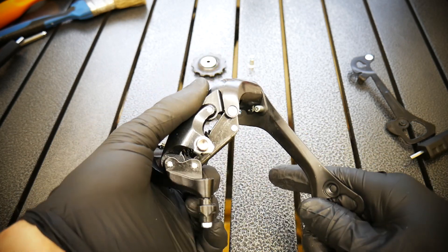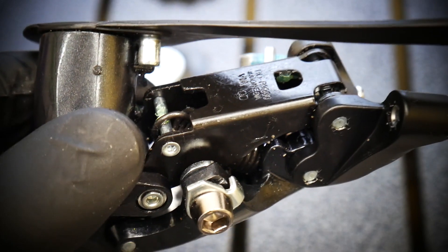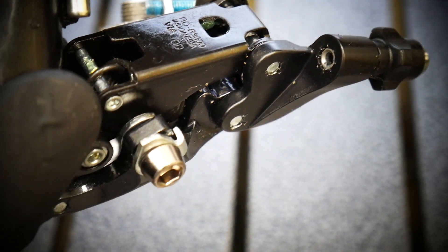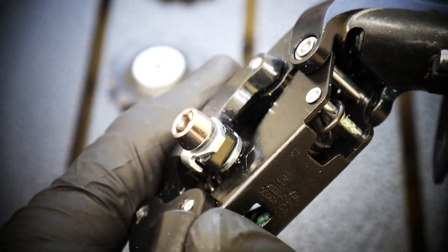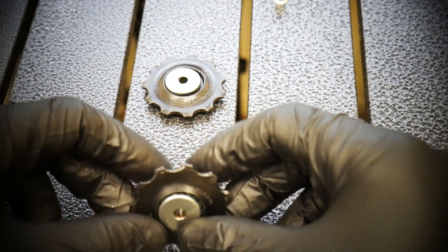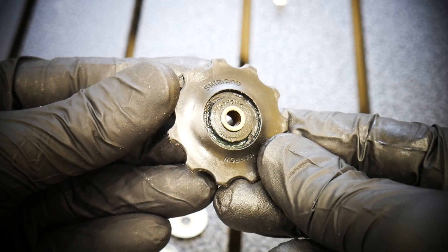You want to have a very nice and smooth movement on these parts. I'm showing you that the new derailleur has got a lot of grease - get rid of it! Shimano bad work, very bad work. Putting just grease all over the place means the derailleur will work okay at the beginning but it will get so much dirt and grime super quickly. Even for a road bike it's gonna get very very dirty - this was only 60 kilometers outside and a couple of rides on the turbo trainer.